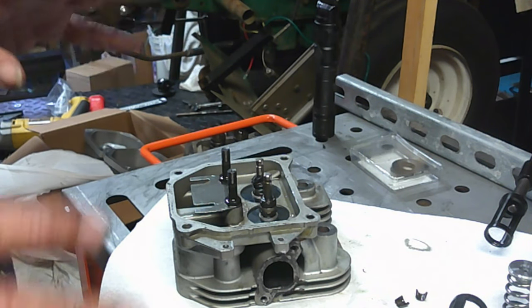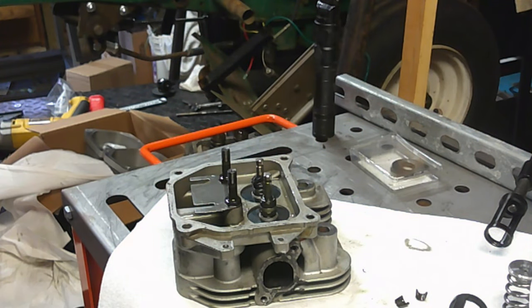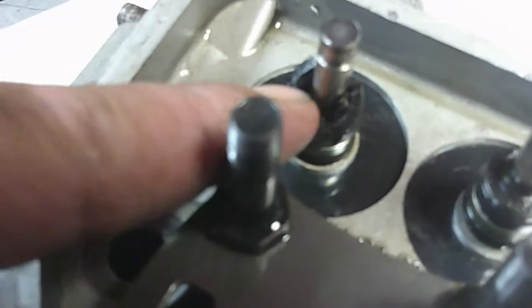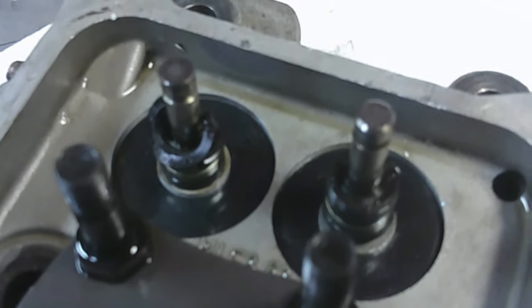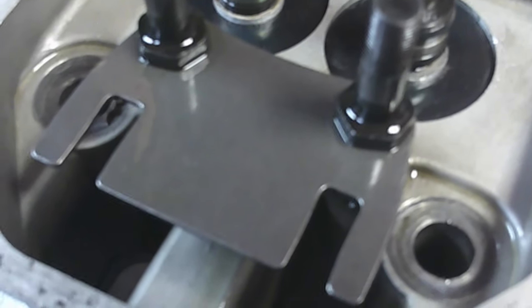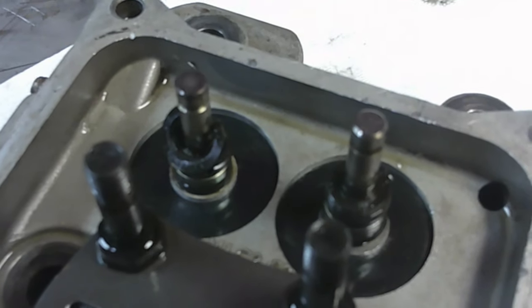You can see here this little raised boss — that little raised section right there in the middle — that's what was holding us up on the inside of those shims. You can see where this is recessed down in here. 30 thousandths on there. I noticed this valve seal was torn up, so I'm going to see if I got any around here and get that replaced. We'll get this thing back together.